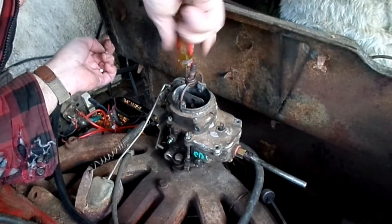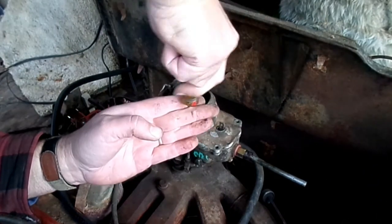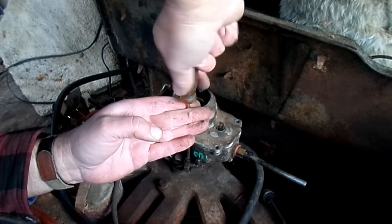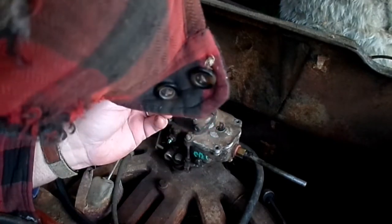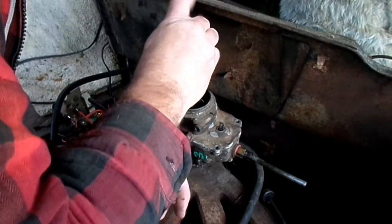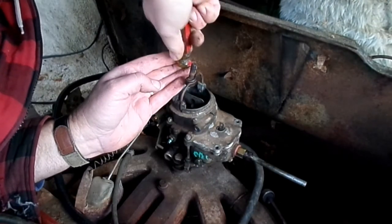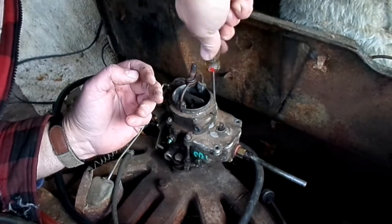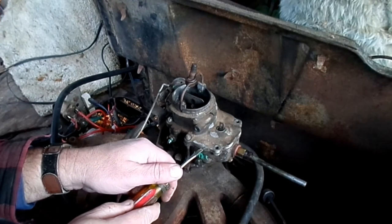So yeah, if you're assembling one of these, just snug these screws down. They don't have to be tight at all. You're dealing with cast aluminum. And plus with these extrusions, or protrusions, whatever you want to call them, it is going to be fairly easy to wreck that if you put your muscle to it. Pressure on it to crush the gaskets a little bit. You got that gasket up here and then a base one.